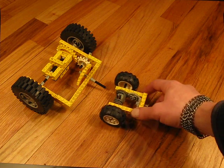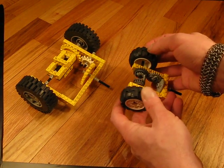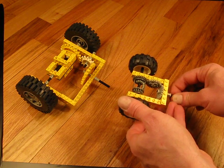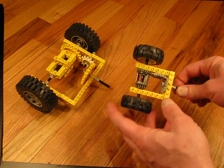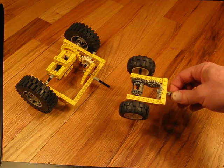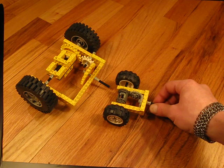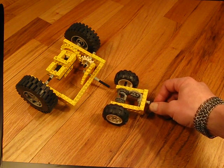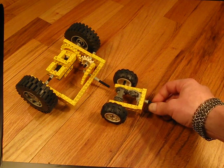The issue comes up that you can take one drive wheel and the other drive wheel, turn them in opposite directions, and see the bevel gears in the center of the differential carrier moving, which is what it's supposed to do. Also, if you turn one wheel, the other wheel turns, which is what you see in a car if you lift both front wheels or both rear wheels, depending on the front or rear wheel drive. The problem is that you can spin one wheel if you apply too much torque — you can see that one wheel is just spinning away and the other wheel is just barely moving.